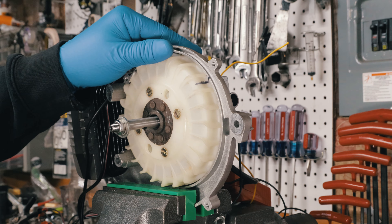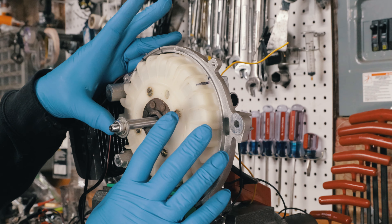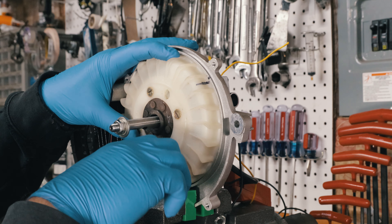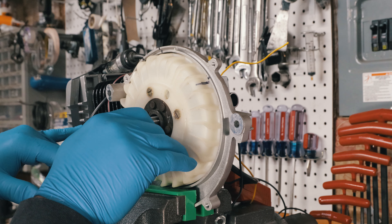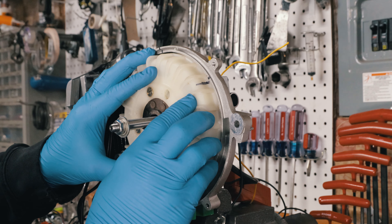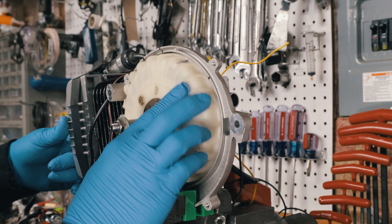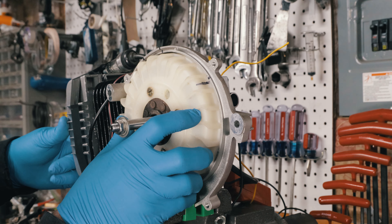This is what's tricky about CDIs — this is where people's brains get a little confused. This is always going to fire when the flywheel is right here. So what we have to do is rotate the crank so that the piston is 1.8 millimeters before top dead center, and then have the flywheel be in this location. Because right now, when the piston is 1.8 millimeters before top dead center, the flywheel is in this position on the crank, and we actually want it over here.